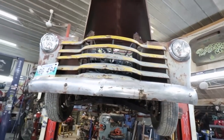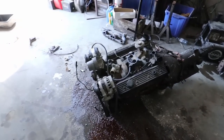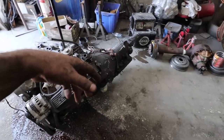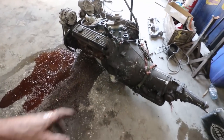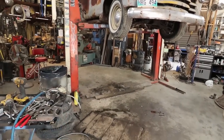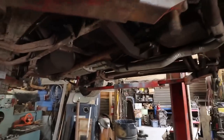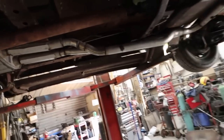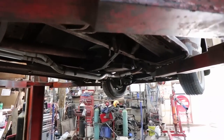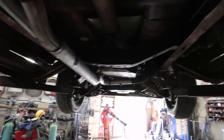Yeah, getting there. It's a straight up small block swap, so swap one for the other. Should be pretty straightforward. This tranny's still good. I know it leaks like crazy, so we weren't going to deal with it, so that's why we just ran the other one. Not really paying attention that it was a short shaft, so whatever. No big deal. I quickly buzzed up a shaft and we're golden there. So now I guess the guys will get everything all finished up in the front. Hopefully fire it up, take it for a rip, see how everything goes.